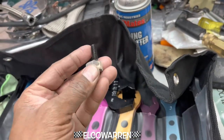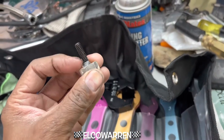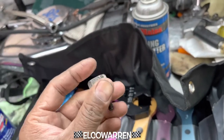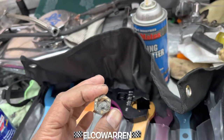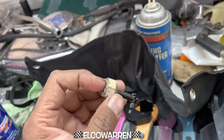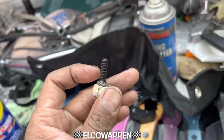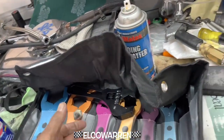So what we ended up doing gang — this is what broke off down inside the head. I kept looking at it and thought: if I take an oversized bolt, put it over there, and put a nice little puddle in there, it'll grab onto that thing and I'll be able to pull it out. So we got that cracking.